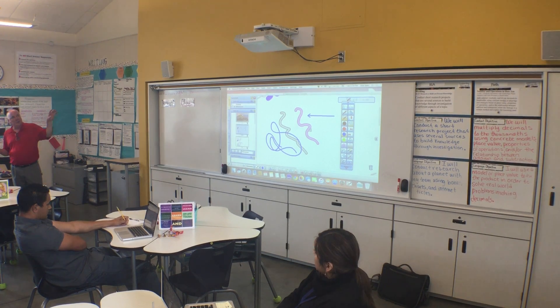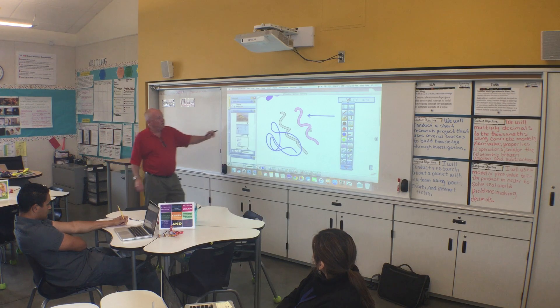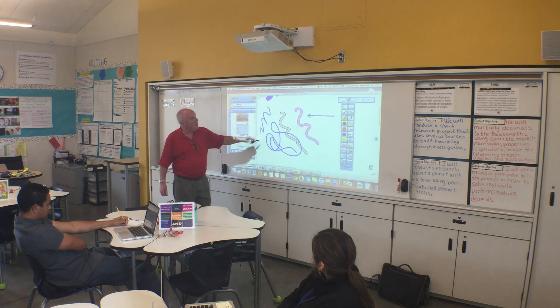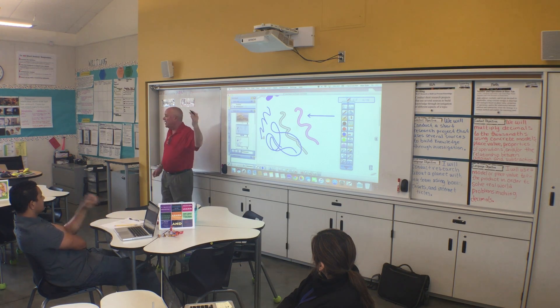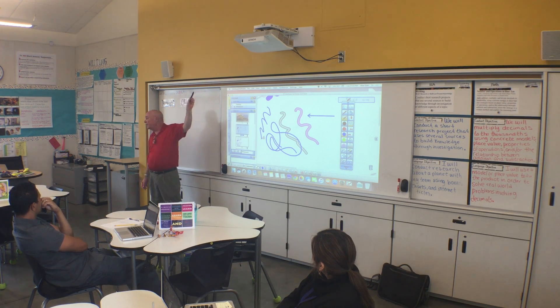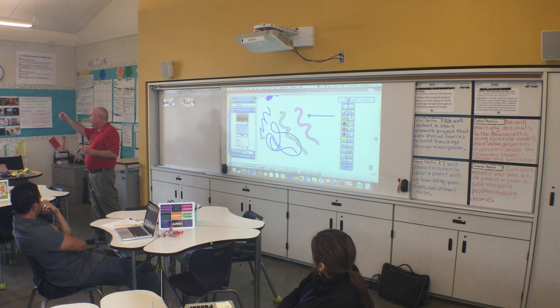So what it's doing now when we're controlling, we're using the mouse mode - just using the drivers to make it a mouse. And when you save something on the screen to the projector, it saves it to the projector. So in order to access that with that one USB connector connected to it, you go into the projector menu and switch that USB from control USB to storage - mass storage.